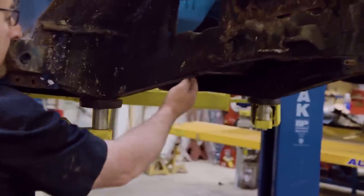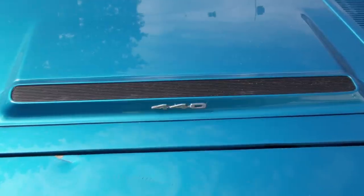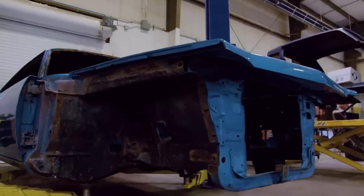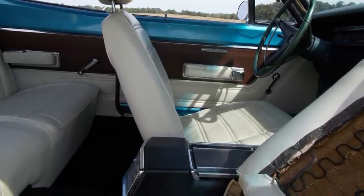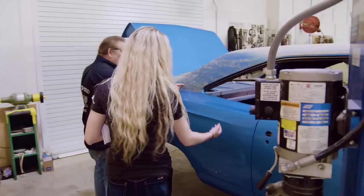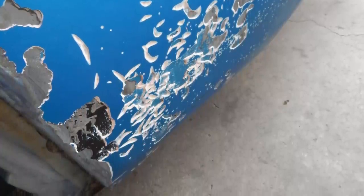As Alyssa and I went around the car, outwardly things looked great — like the trunk floor. It was beautiful, it was blue, it looked good. But you hit that thing with a tool and it'll punch right through because it was all fiberglass. When I talk about hidden sins, I'm talking exactly about this car. It's like that phrase about a house where the carpet hides a multitude of sins like rotten floors — well, in this case, paint hides a multitude of sins. Every single thing on this car had filler on it from front to back. The metal was gone. The car was basically sculpted from Bondo.